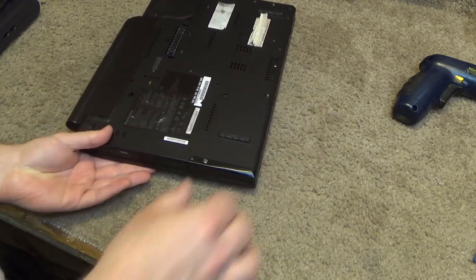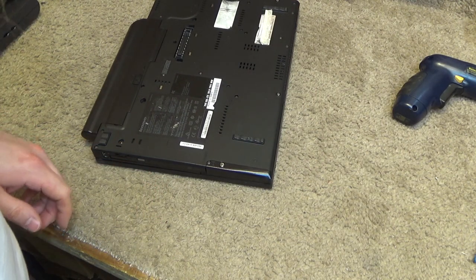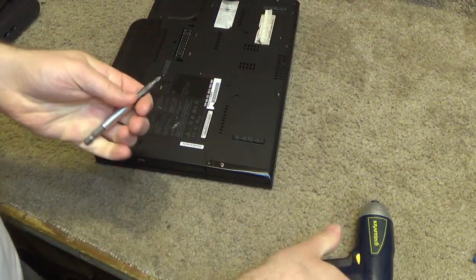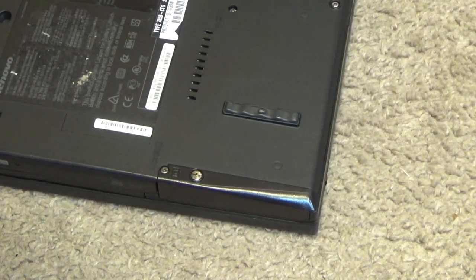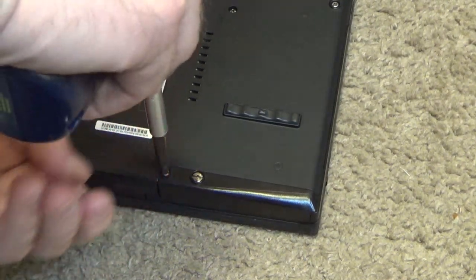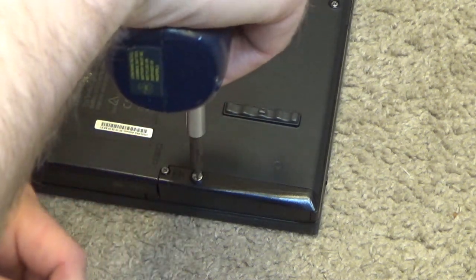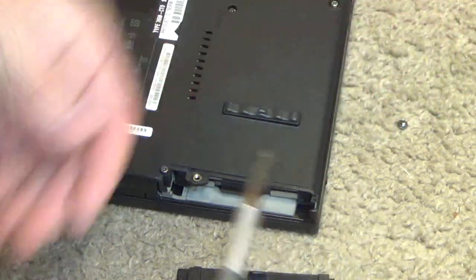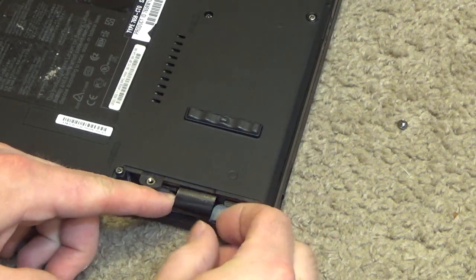So I need to change the drive in here and we'll upgrade the memory. The drive is over here — I'm not sure what kind of memory it takes, we'll find out momentarily. Let's get the drive compartment open. I suspect it's a SATA drive. Well that screw has to come out — actually that screw has to come out eventually anyways because the keyboard has to come out.